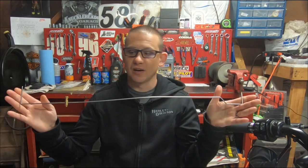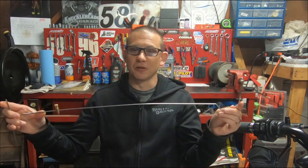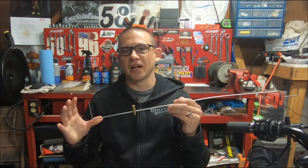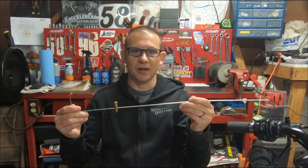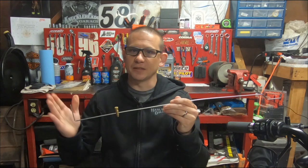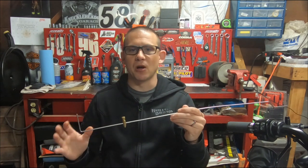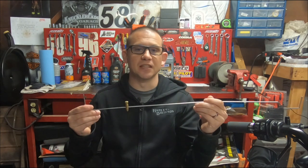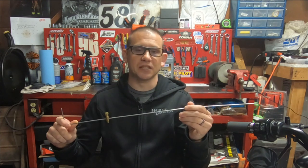For chain drives, since they don't have indexing marks and proper alignment is critical, Motion Pro has some tools that work really, really well. I picked one up from Motion Pro — it's just a little piece of wire with a little indicator on it. I use it to check my wheel alignment when adjusting my belt, and I also measure with a tape measure just to make sure everything's spot on, since there are no indexing marks on these bikes. If you convert to a chain drive, Motion Pro also has a tool that will help you get your chain lined up.